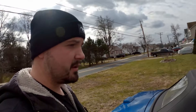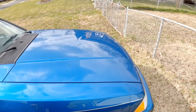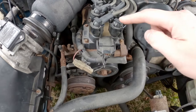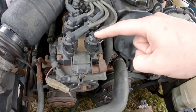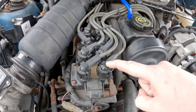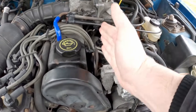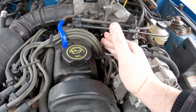It is my understanding that if you simply change around a few spark plug wires on the main coil pack of these twin spark engines, then it helps with power. So supposedly all you need to do is swap this one with this one, and this one with this one. Apparently, the way this is set up now, this coil pack fires this side of spark plugs on the exhaust stroke, which is supposed to help with emissions.